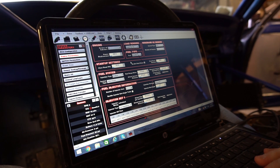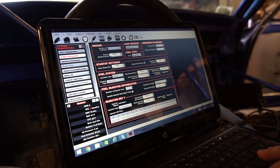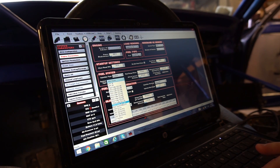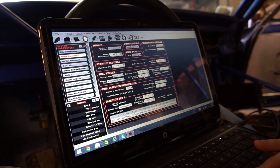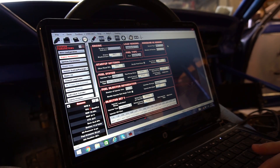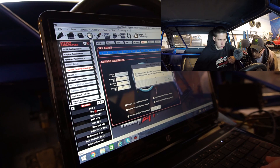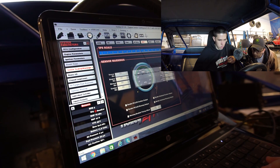Fuel type I leave at gasoline because I just watch the fuel reading - that's all that is. Speed density, NTK - it's one sensor, right? You're not running dual NTKs? Single NTK, yeah. And then right here, system type Holley 160s. For the O2 sensor you only get two options: NTK or Bosch. NTK is what's in mine - that's what I have.